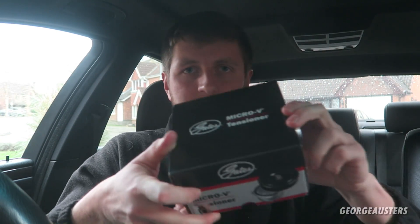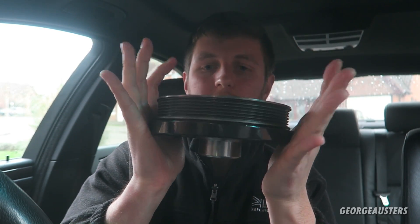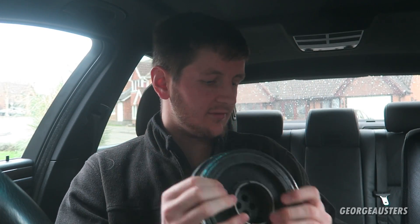What's going on guys, welcome back to another video. Today I'm going to be replacing the entire drive belt kit on the BMW, which comes with the belt itself, the tensioner and the idler pulley. Along with that I'm also going to be replacing the crankshaft pulley, which is also commonly known as the engine dampener. It dampens a lot of vibrations on the engine but it is common for that to fail anywhere between 100 and 200,000 miles. I plan on keeping this car on the road for a good amount of time, so I'm going to be replacing the whole lot.